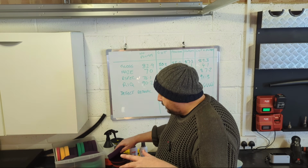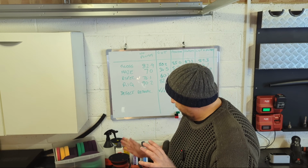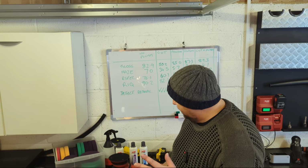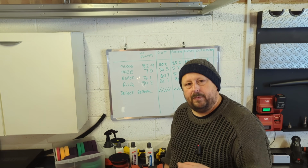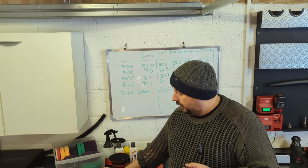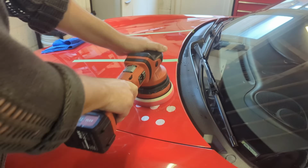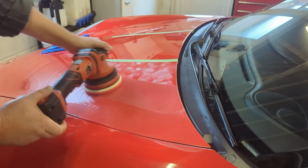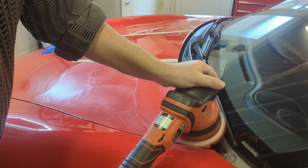Now, with polishing and finishing, it's essentially the same thing, especially with this mid-range polish on this particular mid-range pad. The only thing I'd say is with using the finishing polish, you might perhaps want to use a smaller amount. So where you're using bean-sized blobs on here, or those big peas, what they call broad beans, or kidney bean size, on here you'd be using round pea sizes and 4 of them.